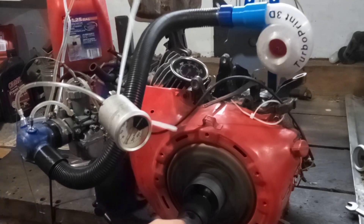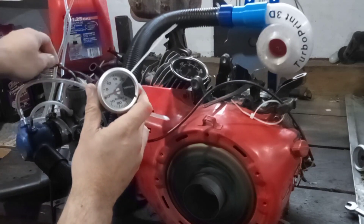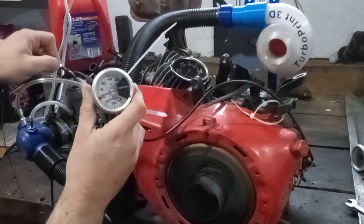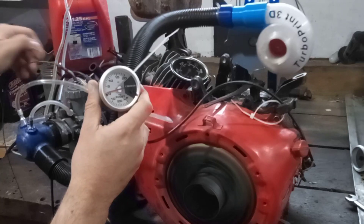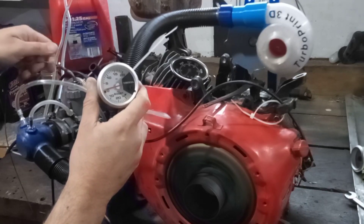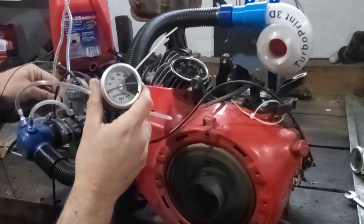With the supercharger connected to the carburetor's hat, I had to mess with the bleed-off fuel system — which is a terrible design, by the way, and I plan on removing and updating that next. I managed to get it tuned to where you can see it pushing fuel into the engine, which means there's a slight positive pressure outside of the carburetor at idle. After a few throttle pulls, I'm seeing about half a pound of boost under open throttle, and then the boost jumps up when the throttle is closed.